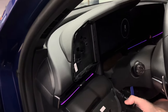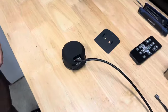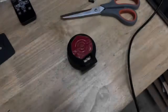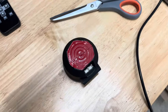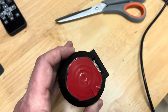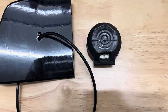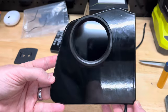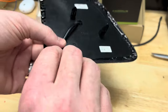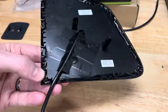To remove the cover, take a thin plastic removal tool and go around the outside of the piece, prying towards you. Be careful when prying up on this piece. If you want to hide the wire, you'll need to drill a hole to allow the wire to attach to the gauge from behind. Due to the depth of this section and how the plastic cover attaches to the dash, I decided not to cut a large hole and try to flush mount the gauge. Instead, I chose to attach the gauge using 3M double-sided tape. I cleaned the back of the gauge thoroughly with alcohol, then covered the back with 3M tape. I also removed the gauge's base since I would not be using it to attach to the dash. Before I installed the gauge, I had my wife wrap the dash piece in gloss black vinyl to hide the white circle printed on the dash piece.